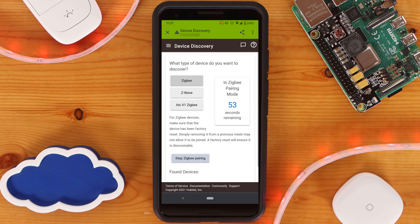The sensor also works with a Hubitat hub by adding them like a normal Zigbee device — no need to change any device types or anything like on SmartThings. Just start Zigbee pairing on Hubitat, remove the battery spacer from the sensor, and wait for the sensor to be discovered.